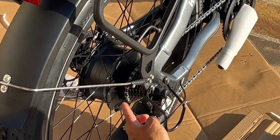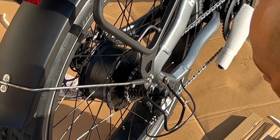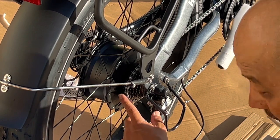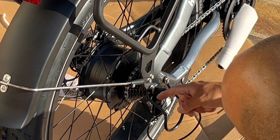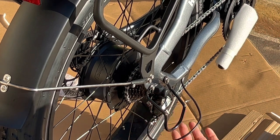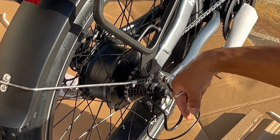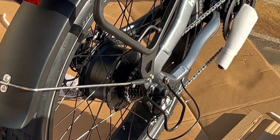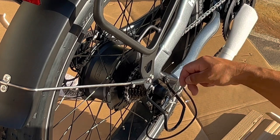The chain is actually on the second gear — there are seven gears. The top, biggest one is first gear, down to seventh. You will have to make sure you move the chain back to seventh gear to see if the derailleur hits the derailleur guard — that will be very important. If you don't make sure the derailleur can travel completely, and you ever run out of batteries and need to use all those gears, you're going to be hating life if the derailleur won't shift because the chain is hitting the derailleur guard right there.